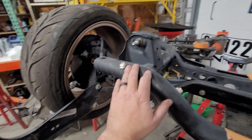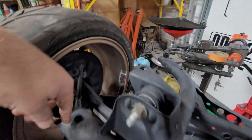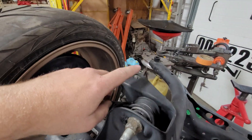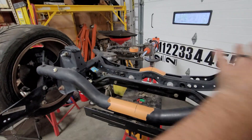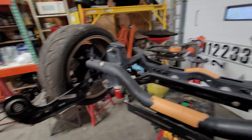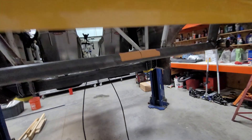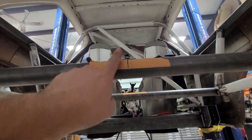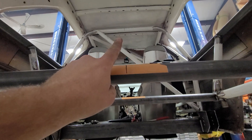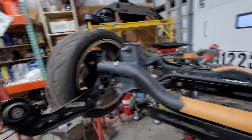The Mark VII GTI subframe has the front trailing arm mounts. It has two mounts on the subframe here and here, and then one small tab on the top. I built a little bit of a pseudo subframe on top of this before placing it under the car and setting it. I've got that welded in now. The orange tape represents the center — there's a spot just right there. That's the center of the car, here's the center of the car, there's another piece of tape, and the subframe has the same. That's how I got everything aligned.